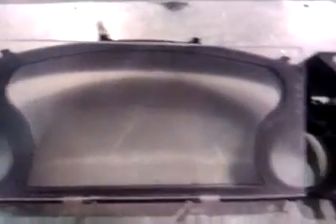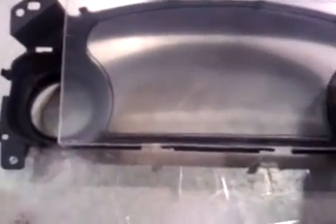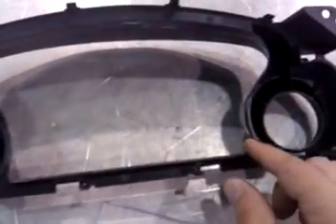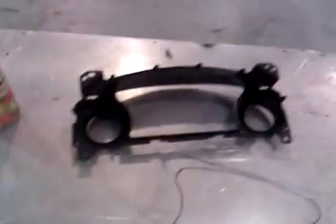I've cut out a piece of plexiglass and left the plastic film on so I could draw on it without affecting or scratching the actual plexiglass. Right now it's perfectly square, but I'm going to trim about a quarter of an inch outside this line, and then I'm going to grind the lip on the inside down an eighth of an inch so my plexiglass will fit right on the backside and still have enough clearance for my screen.